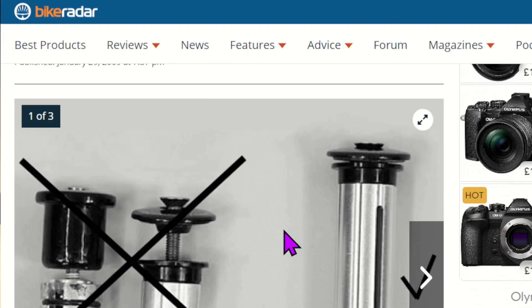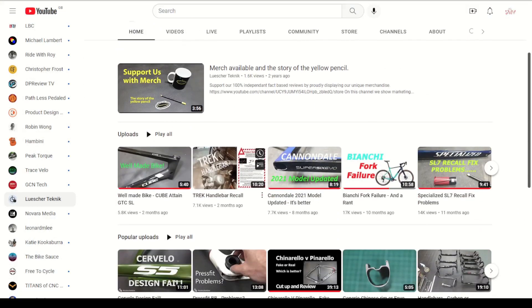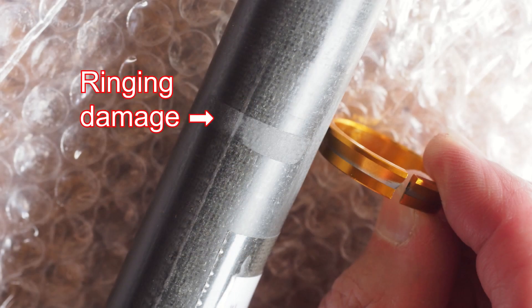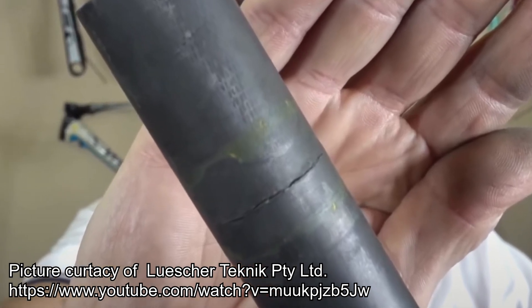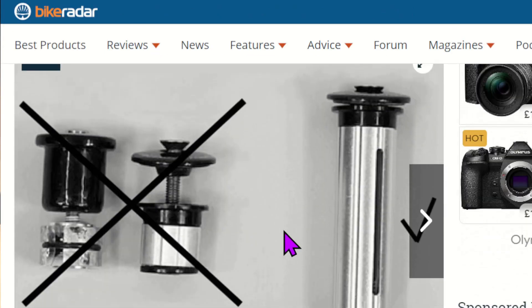Failures can start at design or manufacturing flaws, and the best thing you can do is to avoid them. In general, avoid steerers with more complicated shapes and forks that claim to be lightweight. In this video I'll be looking at ringing, which is a form of in-service degradation. In extreme circumstances, ringing could cause the fork steerer to crack, which is not far from catastrophic failure. I have myself been subject to a fork recall — the recall reason was not divulged, but I suspect it was due to ringing.